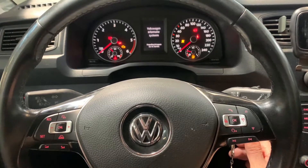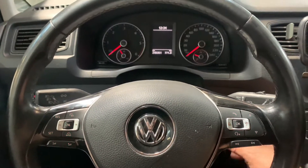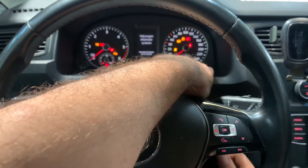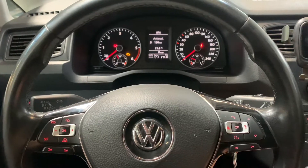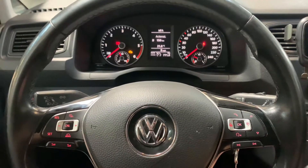As you can see, there is no indicator anymore. So once again: ignition off, press the Set button, keep pressing it, turn the ignition on, let go of the Set button, and press the OK button — for resetting the oil indicator of the Volkswagen Caddy, manufacturing year 2016 till 2020.